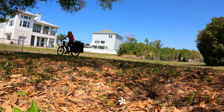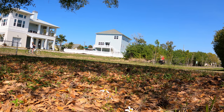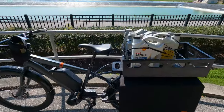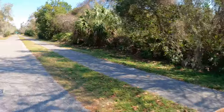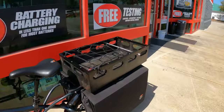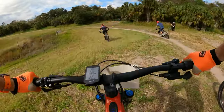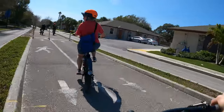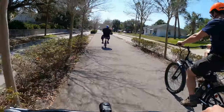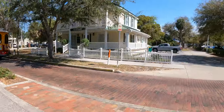So how does it ride and haul stuff? I have over 200 miles on the bike so far and have been loving it. It is so nice to be able to stay out of the car and ride to the stores. Having this e-bike does not take away from riding a normal bike — the only thing it does is remove miles that I would have driven by vehicle. I'm really impressed with the Bafang kit. I have ridden and actually raced a Specialized Turbo Levo, which is also a mid-drive e-mountain bike and considered one of the best. The Bafang has more power and is just as quiet, but is not as polished an experience. This Bafang is a cadence-based system where the Turbo Levo is torque-based. I prefer torque-based; however, cadence-based is not bad as long as you understand how it works.